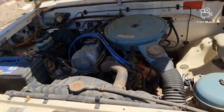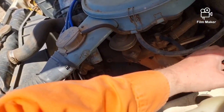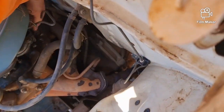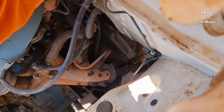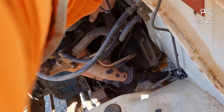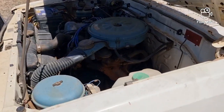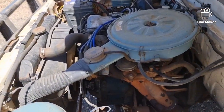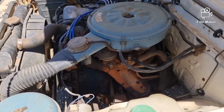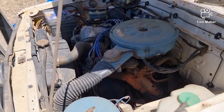Maybe a single 45 Weber - I think I've got a single 40mm Weber here. That side rail - yeah, that's blocked off, that's right, it doesn't do anything anymore. Smokes a bit - probably could do with a set of plugs. I did look at the points but never actually cleaned them, so even just doing that. That carby might be a bit dodgy too - that low speed jet might have had something in it.